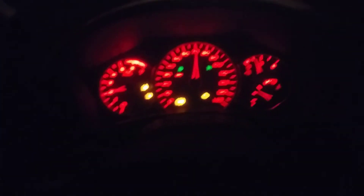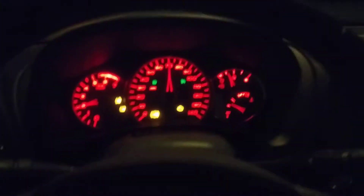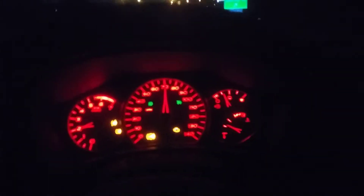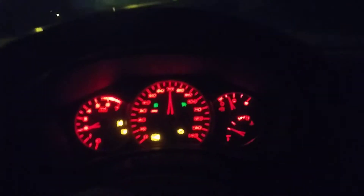It's running pretty good. It's still got an exhaust leak somewhere, because I can hear it. But it's not at the resonator flange, so it's either got to be at the V-band, or on the crossover pipe, or at one of the heads, because I fixed the leak at the EGR, and I put a new gasket on where the downpipe meets the resonator flange.